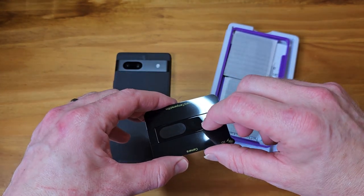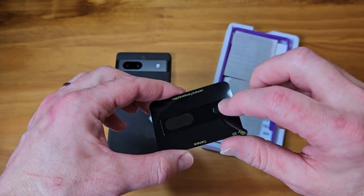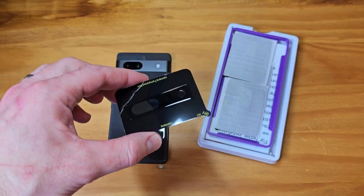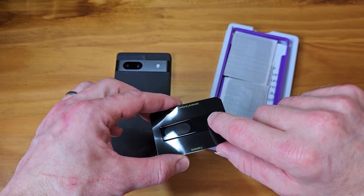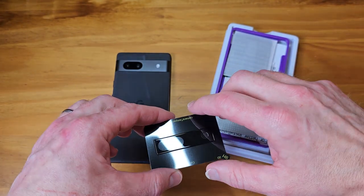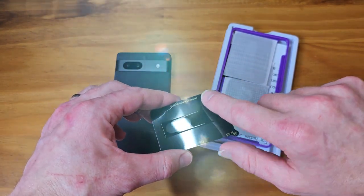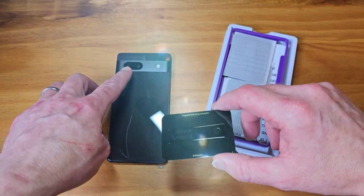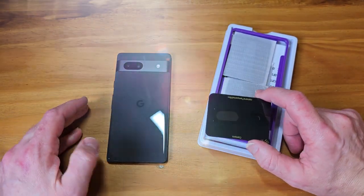It's going to say, oh, it's new and improved. It has a glass cover for the cameras, and it's got a cutout for the flash. In the past, it would be all glass. There'd be no cutout. Now, you could see through it for the flash, but the issue is when you took a picture with a flash, the flash would illuminate this whole glass panel, and your sensors at night would have a flash flare to the photo. It would mess up the photo.